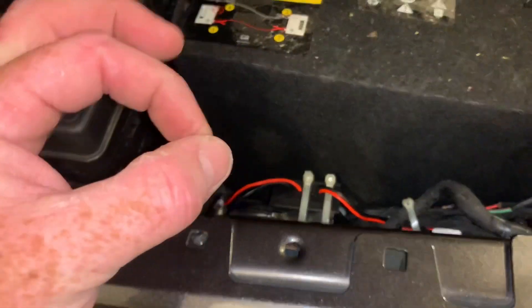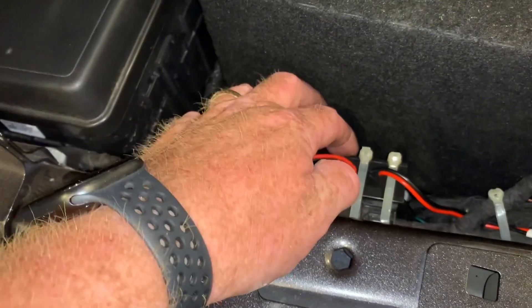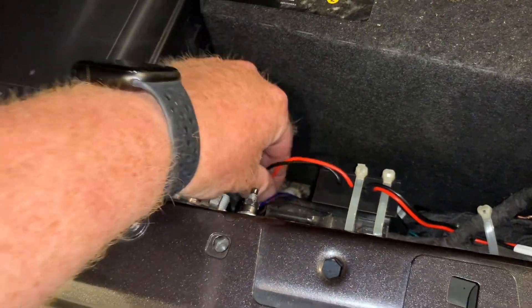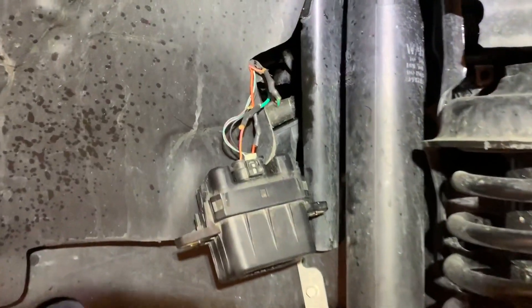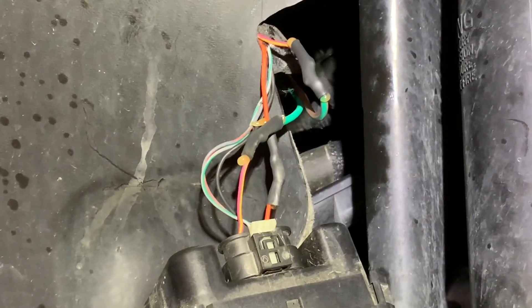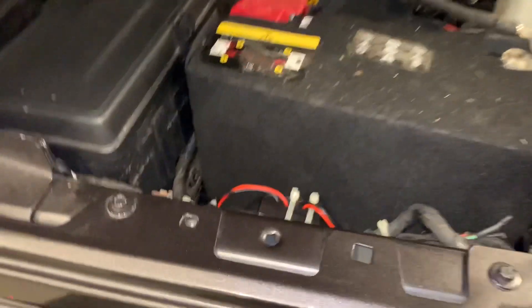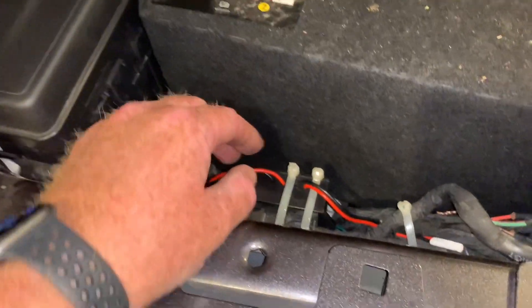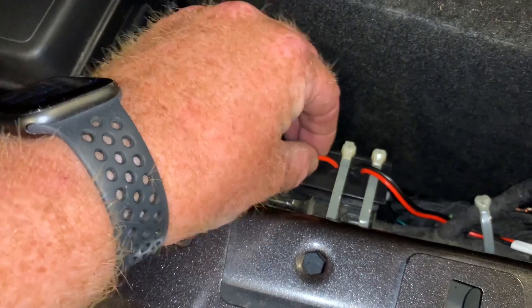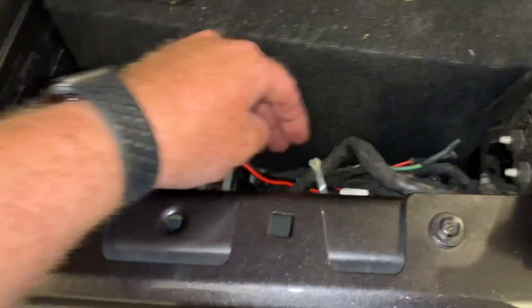The normally closed loop is like a light switch on the wall — it's on when this relay is inactive. When I put power to it, it opens that relay. That relay is hooked to a wire that goes down — I'll overlay some video I took earlier when I had this tire off — that shows the wire, I think it's pink with yellow, which I think is the positive lead to the pedestrian warning system. The front speaker controls the back speaker, so if you power down the front speaker, you power down the whole system. So the positive power to that pedestrian warning system is now running through this relay, which I have connected to the Aux 4 button.